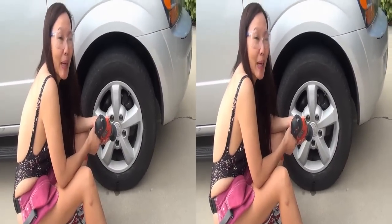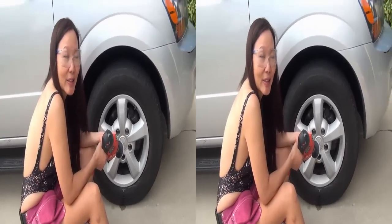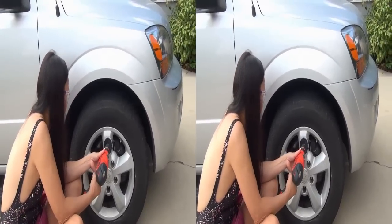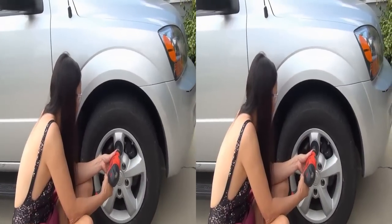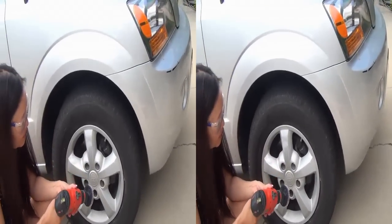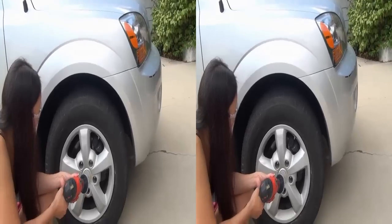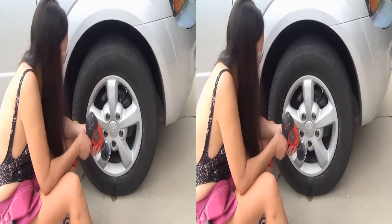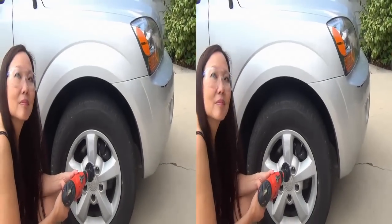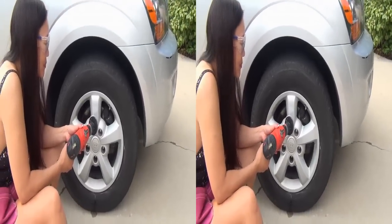Which is what we do, because part of it is we do have a painted wheel that's coated. Two things that they tell you not to do: don't do it with a wheel that is painted or coated. The problem is that you can get damage to the wheel that takes the paint and the clear coat off. But you can see the tarnish is basically almost totally gone — the rust and tarnish. We can't do anything about where the holes are from the lug nuts. The damage has been done because it's been hit up against curbing and it takes the clear coat and the paint off. And you've got to get rid of that. That's what we did with their stuff, which they won't recommend you doing.